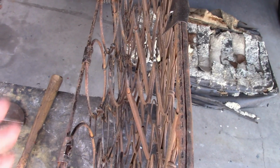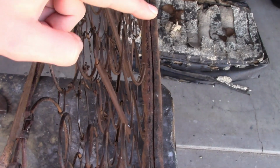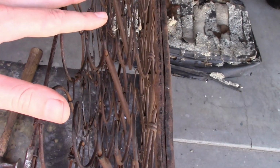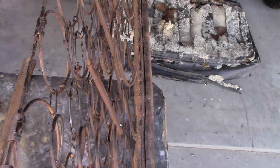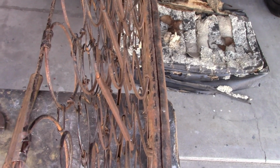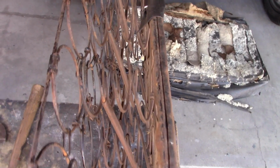Now when these were upholstered originally, the material was held in place by this channel. There was this big machine that compressed the entire cushion to where it should be, and then the material was just put in this channel here and pinched over, and that was it. It makes sense for mass production, but the problem is it can only be assembled once. You can't take it apart and correct anything on it.